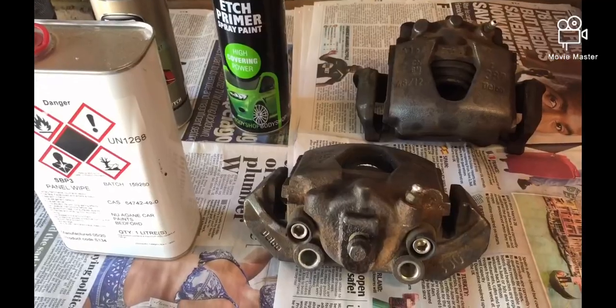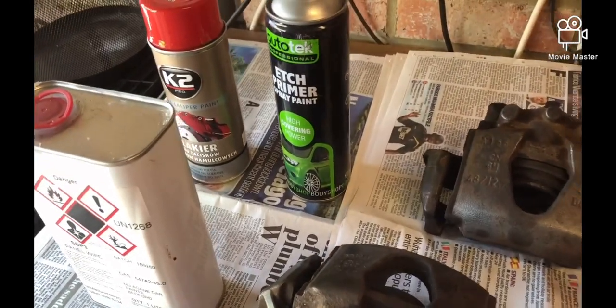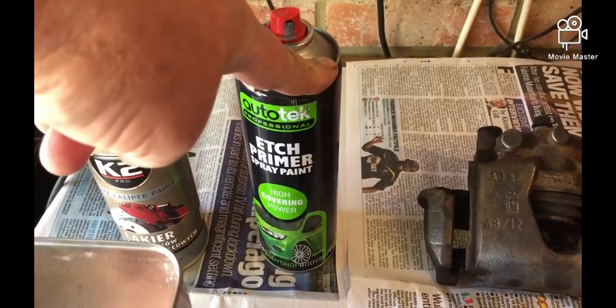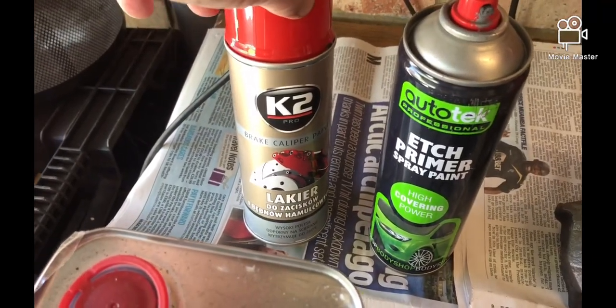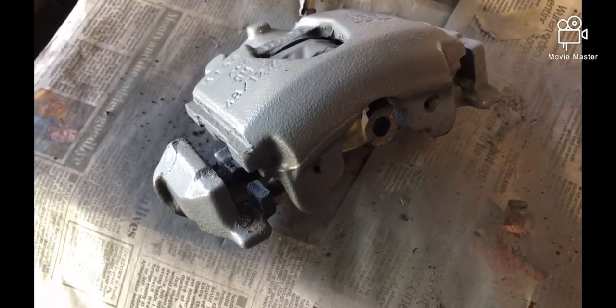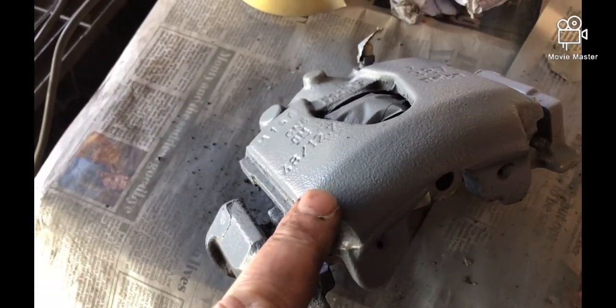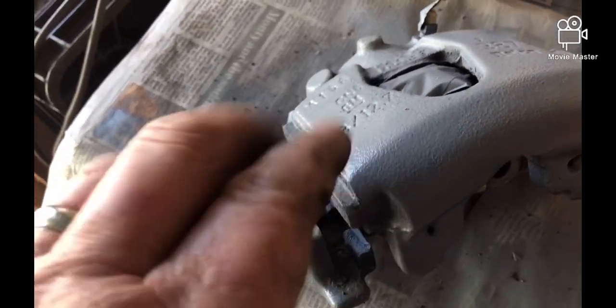So we've got a couple of nicely cleaned-up caliper assemblies and the equipment now to start painting. I'll give it a light coat of etch primer — just basically pulling the paint onto the metal itself. I've got the red brake caliper paint and some panel wipe, and I use masking tape to mask up things like the nipples and places where we don't want any paint — on the rubbers and bits and pieces like that. We'll do our best to mask all that up. The light coating of primer gives the paint something to adhere to, and it also gives us the opportunity to tidy up anything we're not quite happy with before the red goes on.